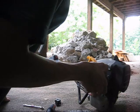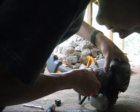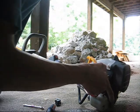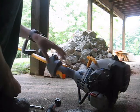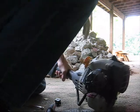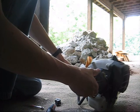Now let's see if this primer bulb works. Well, it's not sucking up any fuel. There we go — the lines were all full, so it took a little while to get it working. Alright, so the instructions say press the primer bulb 7 times. Full choke — that's where it's at. Squeeze the throttle until the engine attempts to start, no more than 4 times. Now I rotate to half choke and pull it until it starts.